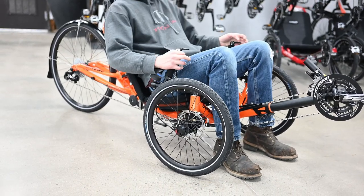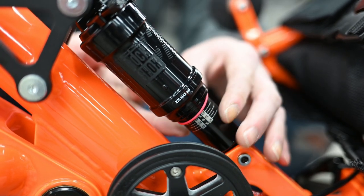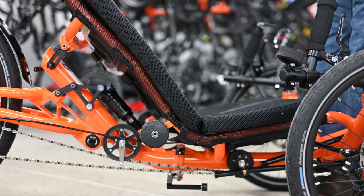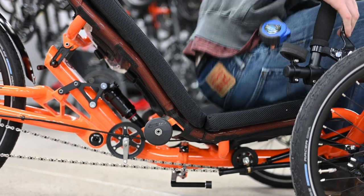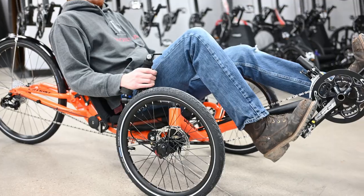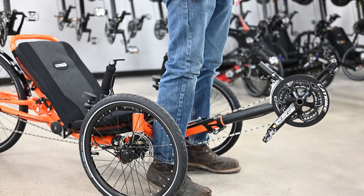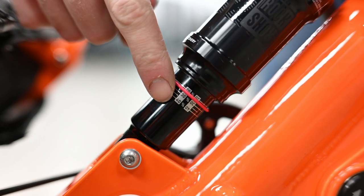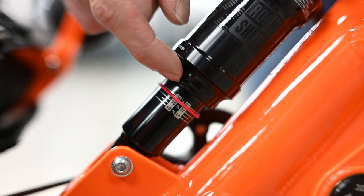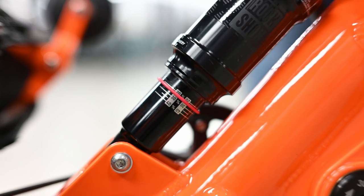To adjust the air shock, start by pushing the rubber band or o-ring all the way so it's flush with the seal between the two chambers. Sit on the trike with all your riding gear on so the weight is accurate — this will cause the rear suspension to squat and the o-ring will move. Stand up carefully, trying not to decompress the shock as you dismount. Check how far the band has moved down the bottom rear chamber — lines indicate 20 to 40 percent movement.